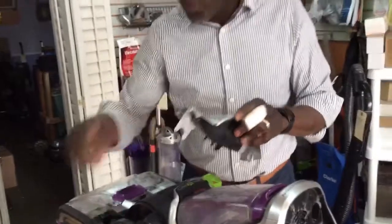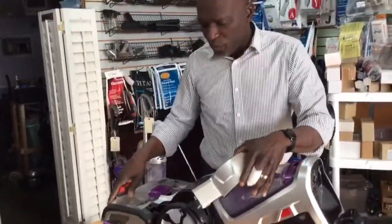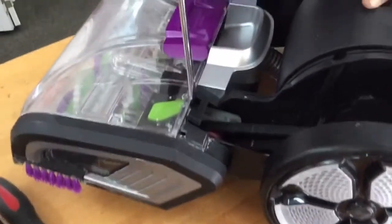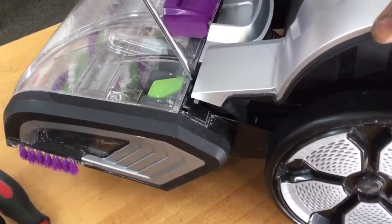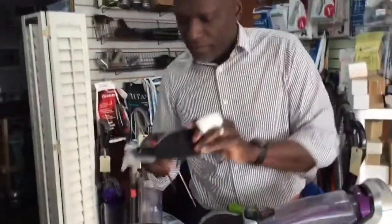And knowing that it's here, it's probably best if you kind of go down right above. You see this push button right here? If you have one of these newer styles right here, just stick in your flathead and kind of pry it, and it'll pop it up. This way you don't break this clip. All right, move that out the way.